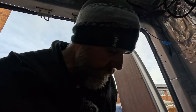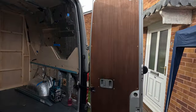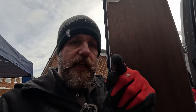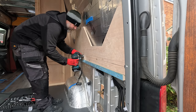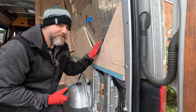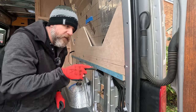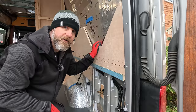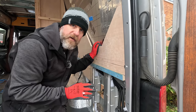The night pixies have been and I have cut some sheets of ply and stained them — that is the 3.5 mil ply and it looks fantastic, it just trims up that door beautifully. Thanks again Steve for sending the templates for that, I'll get them in the post and send them back. Slight change of plan — I put lock nuts on thinking this wasn't coming off again, and what I think has happened is the rivnut is now spinning with the main bolt. It'll never pull off the wall but it means I can't undo them, so I'll modify these with them staying put.